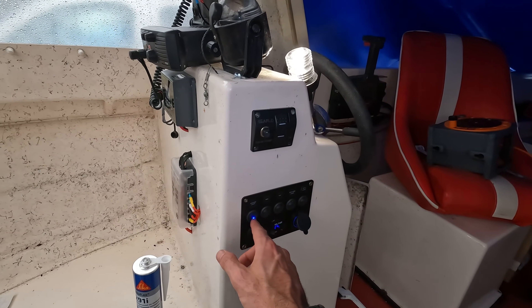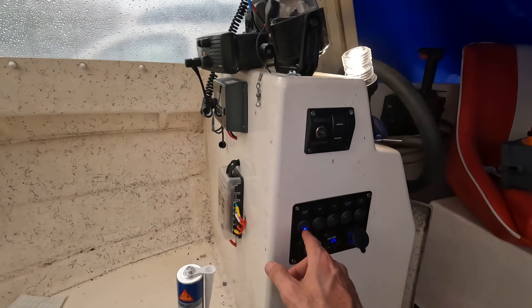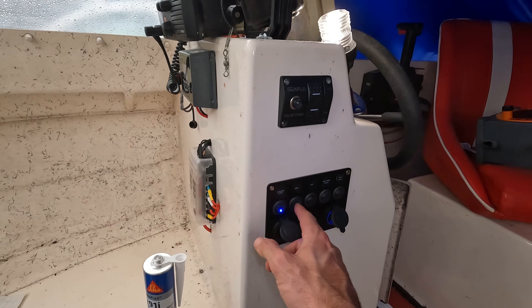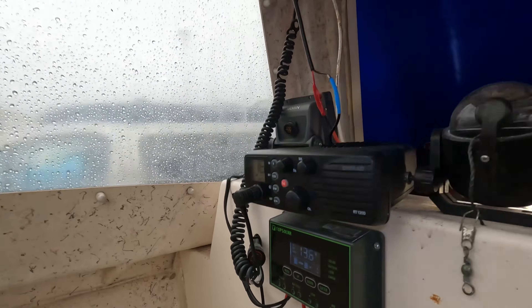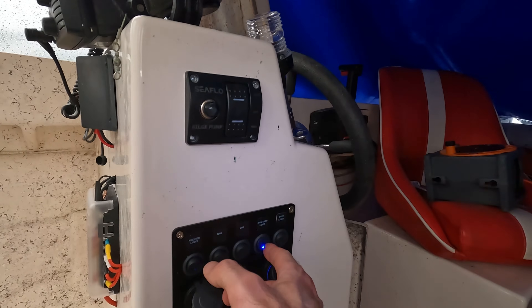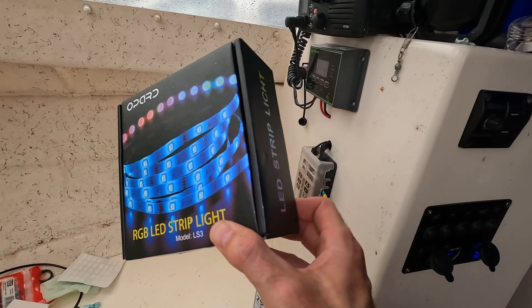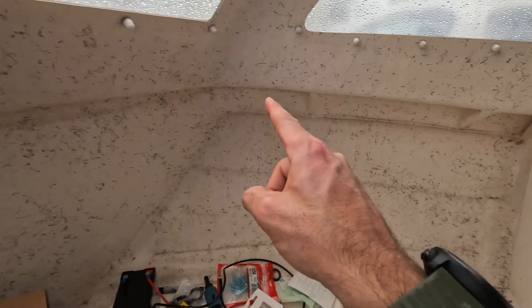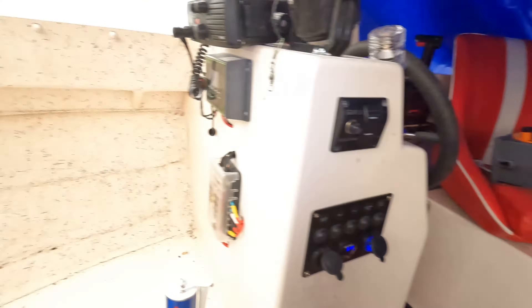Red is my anchor light — the positive connected here and the negative connected back to the fuse panel. Works well. I've kept the neutrals jumped across so there's just one main neutral coming in. For the bottom part of the panel — the USB — I put it on a separate fuse connection so any issues there won't blow the whole switch panel. The GPS is not connected yet. The main cabin lights aren't fitted yet — they're going to be RGB light strips, a 10-meter pack going right under all the gunwales around the entire boat.